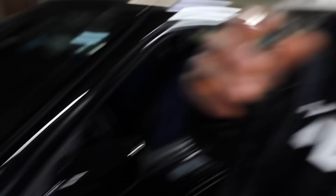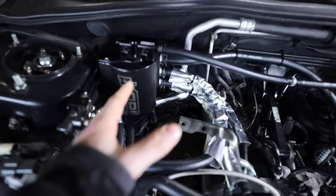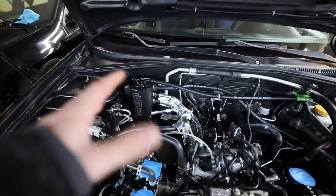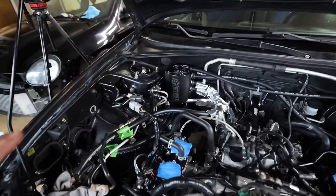There are a couple fittings I had to order to make this work with the Aeromotive fuel kit, but I'll show you everything that goes with this kit — how to do fuel line, how to set everything up. We are going to have to make a custom bracket for the fuel pressure regulator, but it's not going to be terribly hard. In our engine bay you guys are going to see the air oil separator in here with some lines done. I started installing that and I'm working on a video on it, but just don't worry about the air oil separator right now.